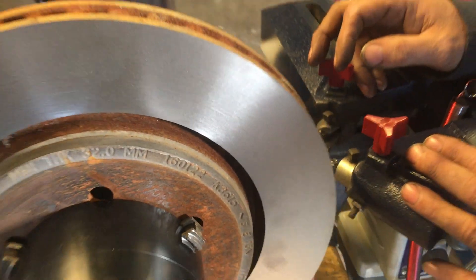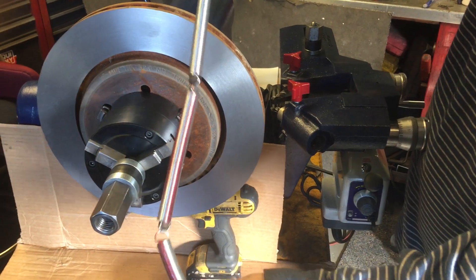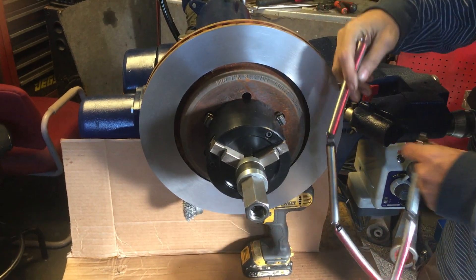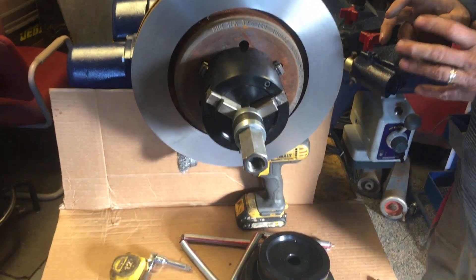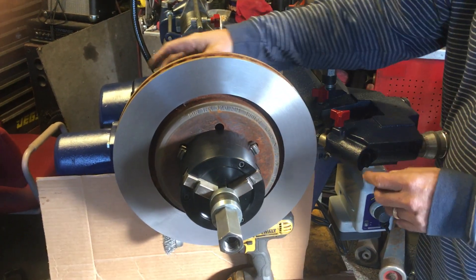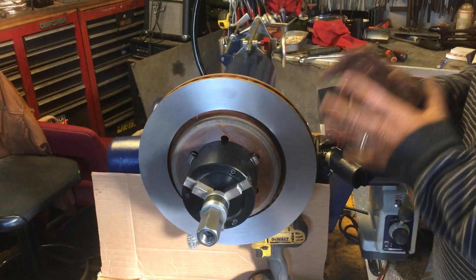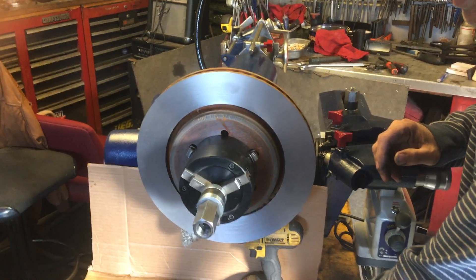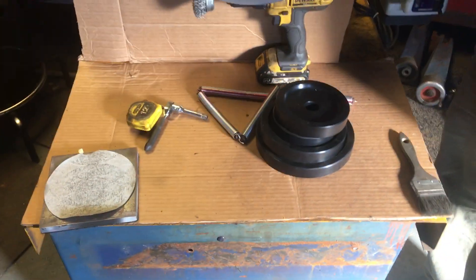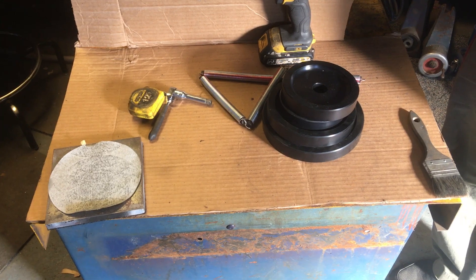As far as cutting a big rotor, different rotors like different silencers. This one with five links — the spring type — seems to do much better on bigger rotors than just about everything else. There's a numerous selection of different silencers that work great: the Anders clamps, the little brake pad thing that clamps on there, the skitter clamps — a myriad of different silencers. The key to cutting big rotors is having the appropriate tooling for that particular rotor. These will do the majority of cars and light trucks, but when you get into really big stuff, you need more substantial tooling to mount that correctly.